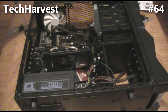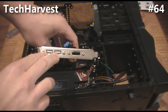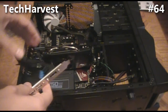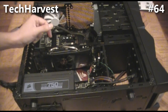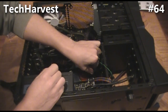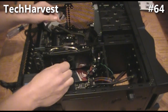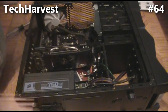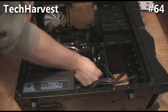The next part of this installation is this expansion bracket, which has two USB 2.0 ports and an additional SATA port. Originally I thought I needed three SATA connectors, but I'm actually going to need four. I had the front port attached to the SATA E1 port, but I'm going to remove it and put it in line with the other SATA ports on the side.